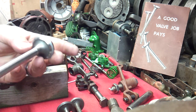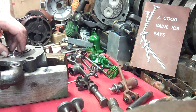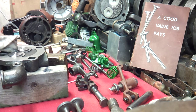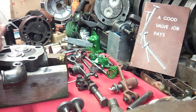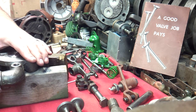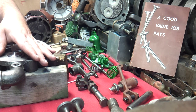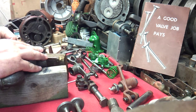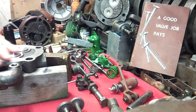The valves on it were really, really good. I mean, better than I ever expected the valves were. And I'm gonna soak this head in some lacquer thinner. There's just no way around it. All these heads that came back from that machine shop will go in a bucket of lacquer thinner. I've been using that lacquer thinner for a while in that same bucket. And something about lacquer thinner, if you don't know this already, which if you used it, you know it: if you leave it out there on the sideboard uncovered, you come back tomorrow, it'll be half gone. So it is that type of solution.